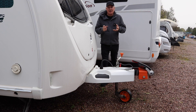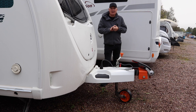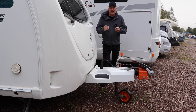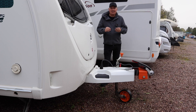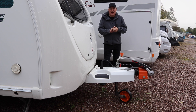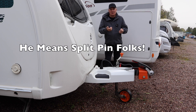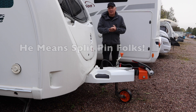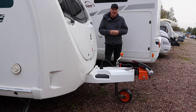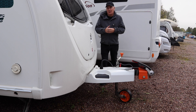That's how I changed the wheel on the jockey wheel - really pleased with the job, very simple and quick to do. I did notice my spindle was covered in grease which is good. If yours isn't, give it a good greasing before you put the spindle back through the new jockey wheel - it'll be a lot easier and allow it to spin more freely. I wasn't happy with the cotter pin bend due to not having my needle nose pliers, so I'll sort that next week when I find them.